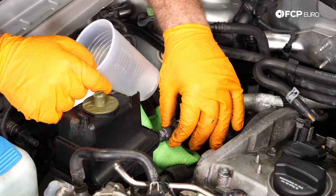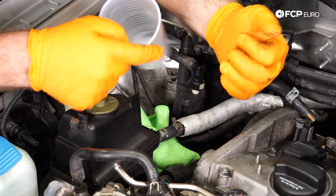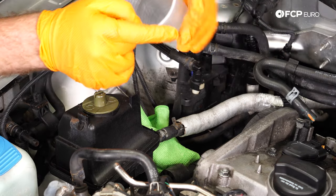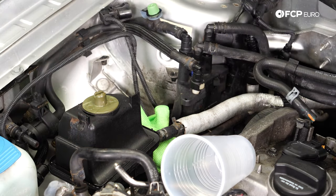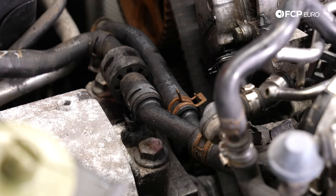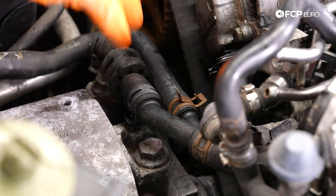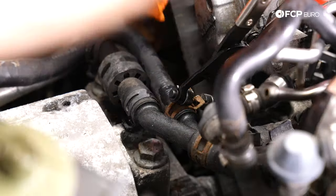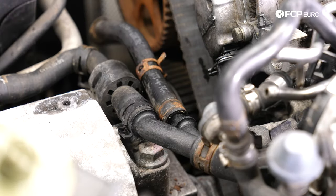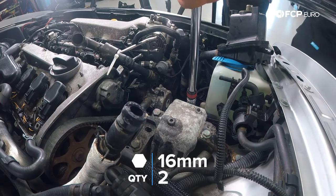The idea is I'm going to take this hose off, take a plastic cup, cap the hose with my finger so no fluid comes out that end, and throw this cup underneath the reservoir to catch the fluid. I'm actually going to disconnect the reservoir first so I can pitch it and get the fluid to flow into there. Now we've got the power steering reservoir out of the way. The last piece in our way hose-wise is this hose right here. I'm just going to disconnect it and then swing the rest of the hose over to the side. Next, I'm just going to crack the engine mount bolts loose — on the body side there are going to be two 16mm bolts.